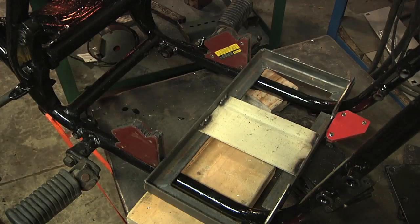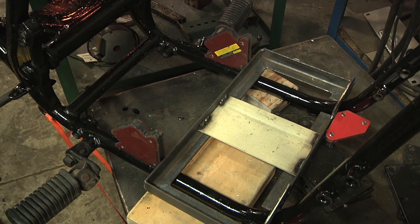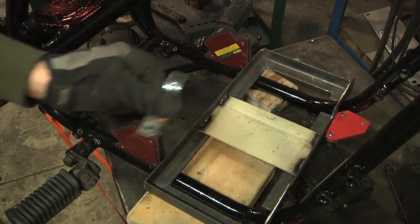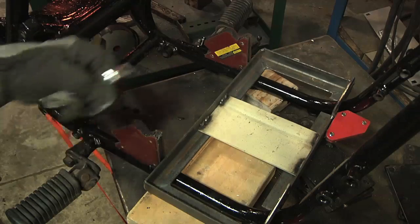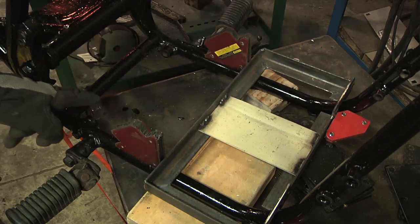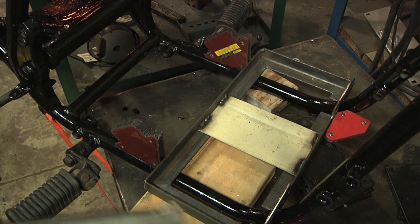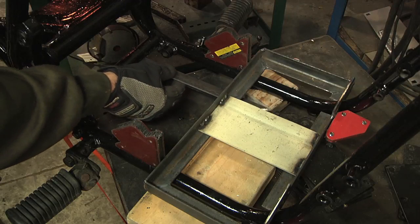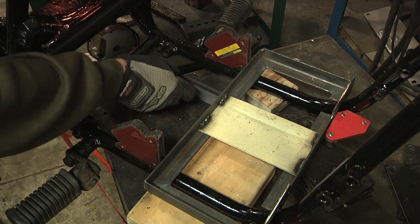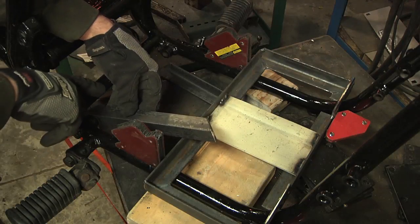Here's the battery rack — it's sitting on top of the frame. There are a couple different ways I could connect it. One, I could clamp it on — this is just a conduit clamp that would go around there and bolt on, though this one's actually a little too big. Another option is that there are some great attachment points already on the motorcycle from where the original engine and transmission bolted in, and I'd like to reuse those. I'm going to take some shorter pieces of steel that will run from one of those attachment points and get welded onto the battery rack — one on each side.